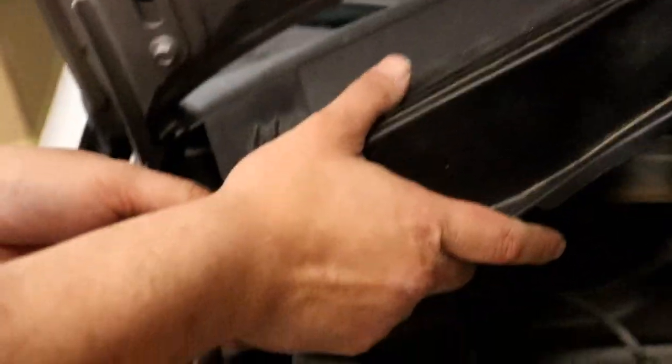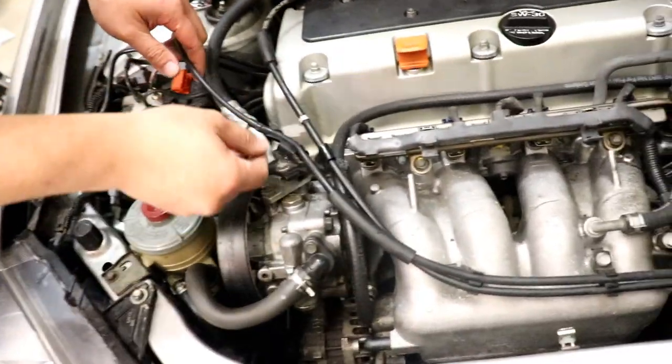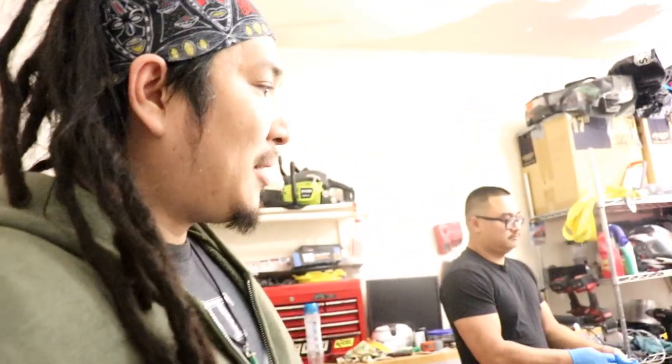Just that one side is held down by screws and stuff — two 12mm bolts. And then this is your cruise cable, so you just got to follow it all the way to the throttle. In case you're wondering, I'm deleting it because I have no use for it. I think the module is on the fritz because it turns on on the dash and everything, but it doesn't actually engage when I try to use the cruise control. So it's useless to me, useless to the car, especially since we're slowly making it into a track machine. It's a completely useless thing and it's going away.